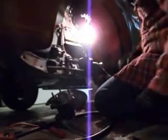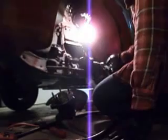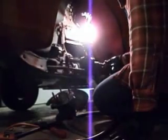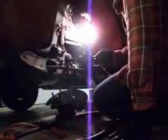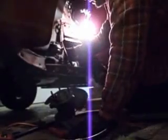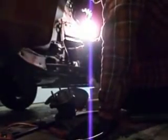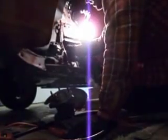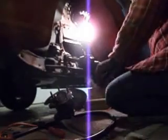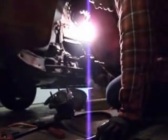Okay, I know a lot of you guys will not recommend this, but I do it anyways, I don't care. Put the nut on the end of the CV axle, straighten it out, and give it a couple taps to make sure the tulip here on the end of the CV axle seats itself on the snap ring in there. And you shouldn't be able to pull that out, it should be stuck in there now after it's seated. So we're good to go there. And so now we're just going to put it all back together again.